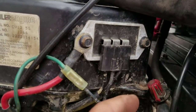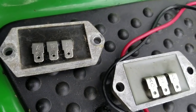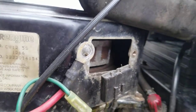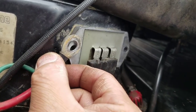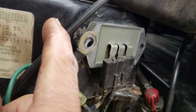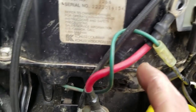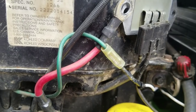I'm just gonna loosen these two bolts and put this on and reconnect it and see if I get anything out of that. It was easy - just two bolts - and I removed it. There's the old one. Just put the new one in just like that. When I got this it didn't have a ground strap. I put this on - I know it needs a ground strap. Even though this is metal, they have other command stuff that's plastic so they needed a ground strap to ground. I added my own ground strap - I know it should be black but that's all I had.